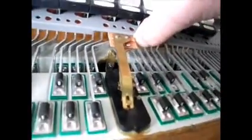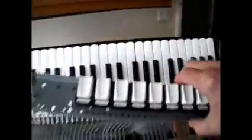Now we've got to take off this coupler control. So there we have those two there, and right there then, let's carefully lift this off here, slide those back a bit. They don't want to come off. And then we've removed the coupler, so we'll just plonk that down there. And you can see where the other two, these two hang down here. That's extremely stiff, that one is.